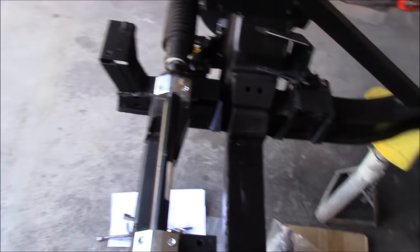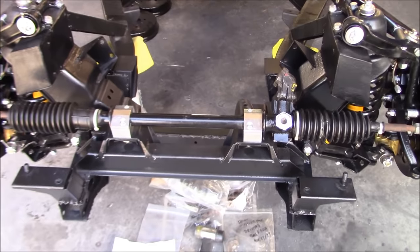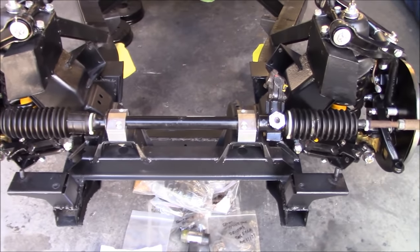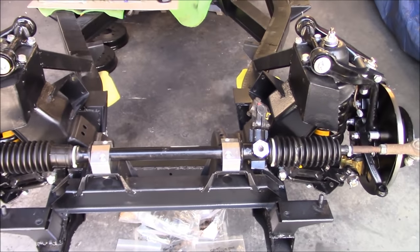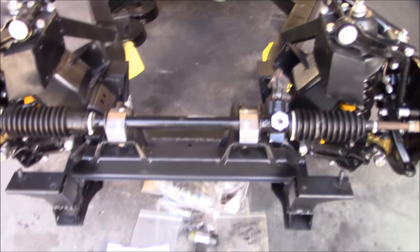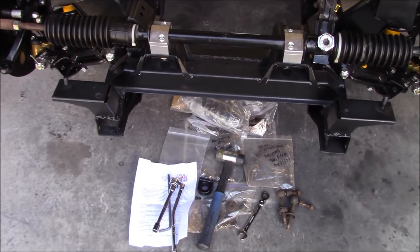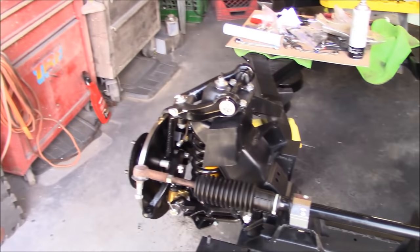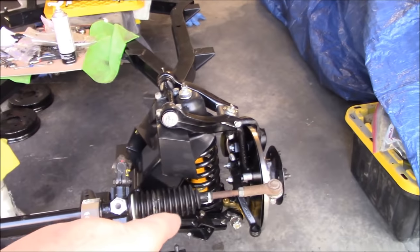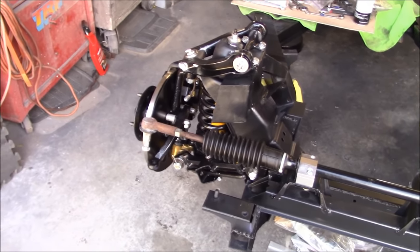I mentioned I got new bushings for these steering rack mounts, but as I'd mentioned, the bushings are not required — these are solid mounted. That's why some guys get more vibrations. The bushings down there on the floor won't be used for this mount. They'll possibly go on another car, maybe on Les' car. We're going to change out the tie rod ends now, scratch the rusty bits with 80 grit and paint them up, then attach these to the steering levers and call the front end done.